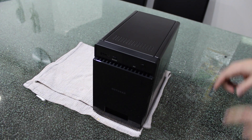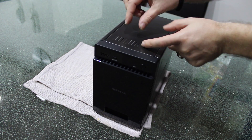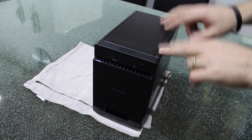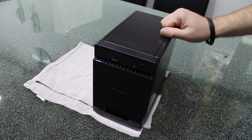Make sure that you've purchased your RAM and that it's going to be suitable for this particular model. If you're not too sure, you can always take the stick out from this one, go to your computer store, and check with them to get you a bigger stick. Currently these ship with a 2GB stick, and we're going to put a 4GB inside of it.